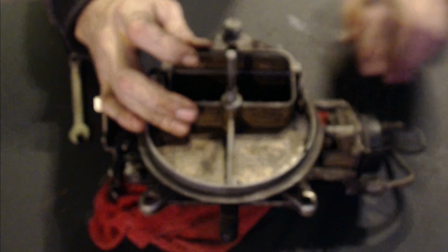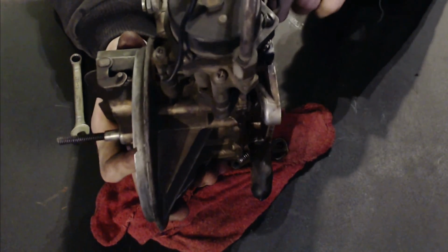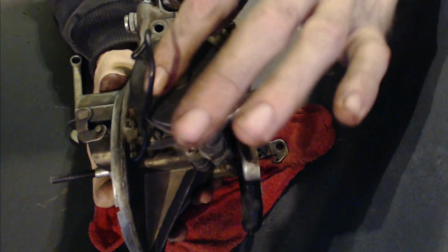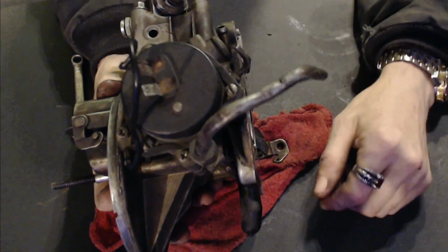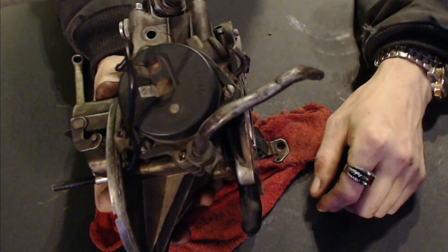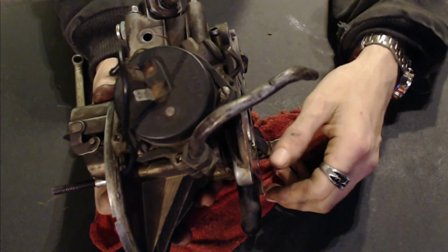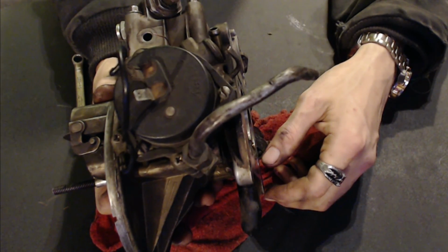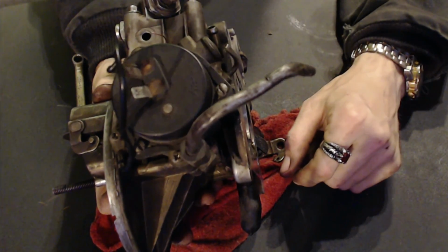This red... I don't know if you can see it. Okay, here's our electronic choke. Right here, your hot coming off your key comes onto right here. This is obviously grounded to the chassis, which I think is actually kind of dangerous, because if you have any fuel leaks whatsoever, and you have a situation where this is not making a good ground, your choke is going to, since there's a coil inside of here, cause a spark.